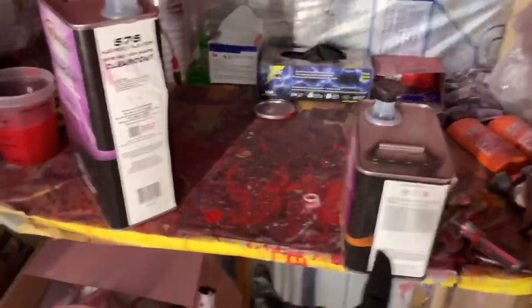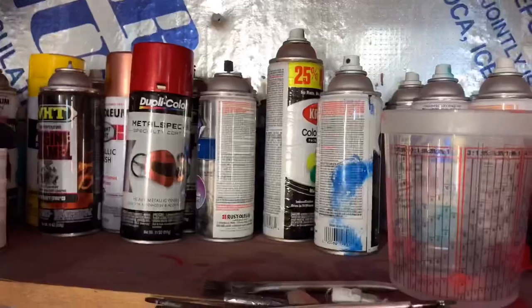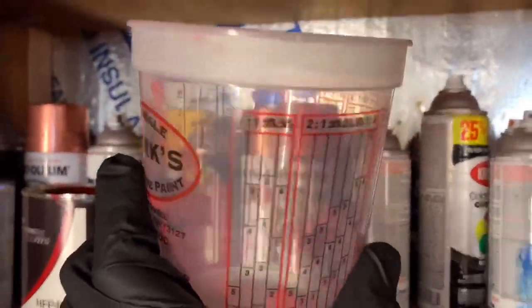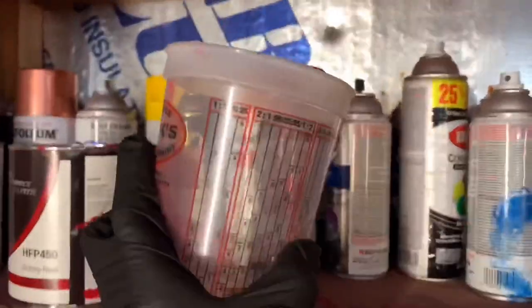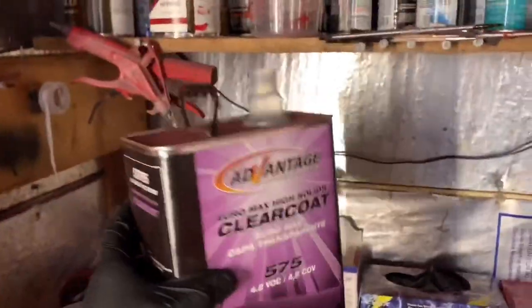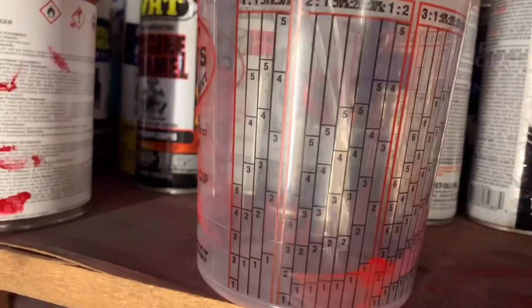All right, man, same rules apply. It's the clear coat. You want that clear, you want that wet. Okay, 2-1. Remember what I said earlier in class today. We gonna find the 2-1 column, because the first number is the column and the main source, which would be technically, this is paint, but first number is the clear coat, second number is the activator. So 2-1, we gonna need a lot. Let's max it out at 5. Y'all see it? Boom. Let's make it happen.